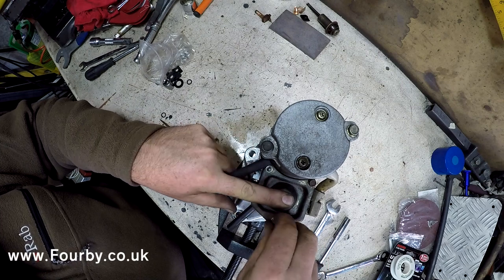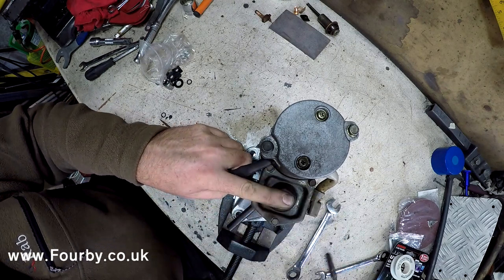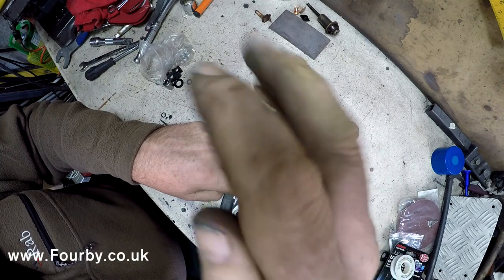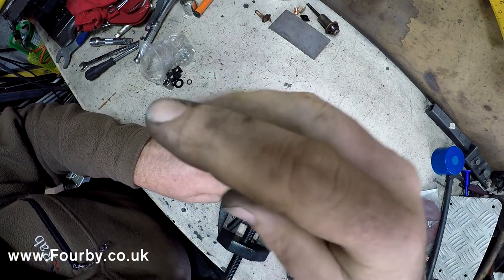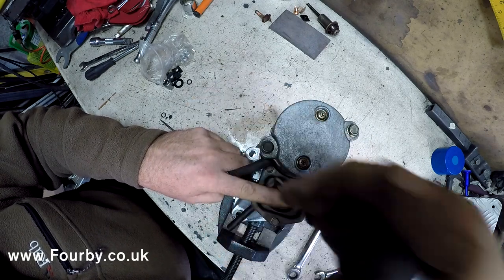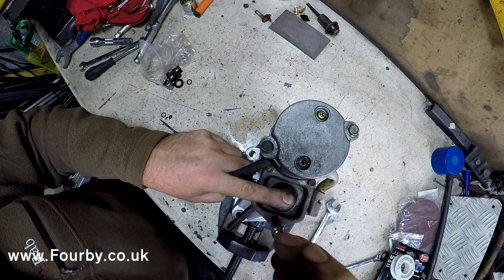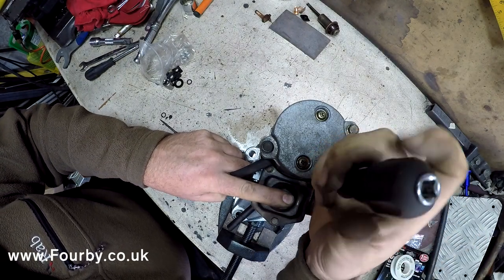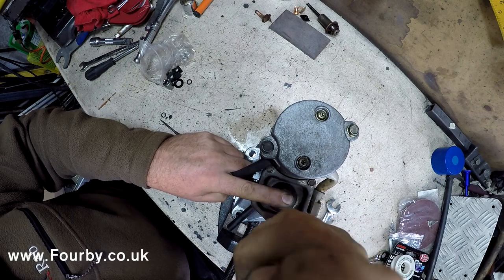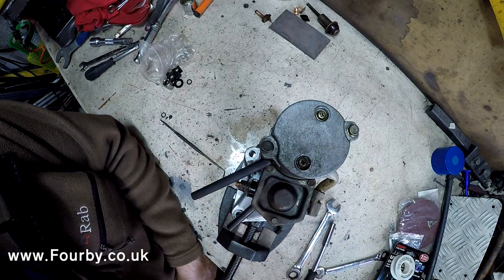Now, I've done many miles in my cars over the years. Off-roading, out in the back and beyond and nowhere. Mostly with other people, but sometimes on my own. And my biggest fear when I'm on my own is my starter motor failing, especially when I'm miles from nowhere. And for the price of one of these kits, you know what, it might even be worth throwing one in the bottom of your toolbox. If you're going on some sort of expedition, overlanding, you've got a few miles on the starter motor, you're not sure what the condition is, change out these contacts either before you go or slam one of the kits in the bottom of your toolbox. And should your starter motor fail when you're out and about, you can rebuild it simply and easily.